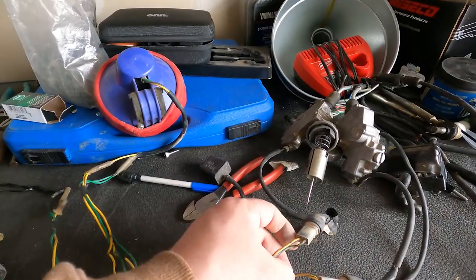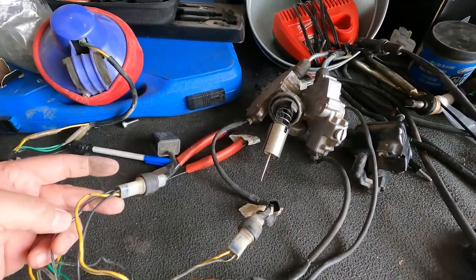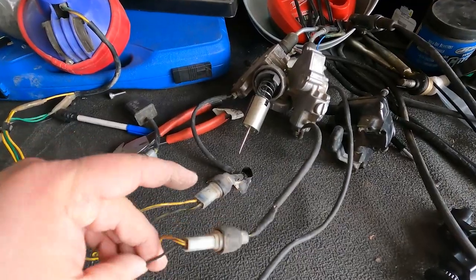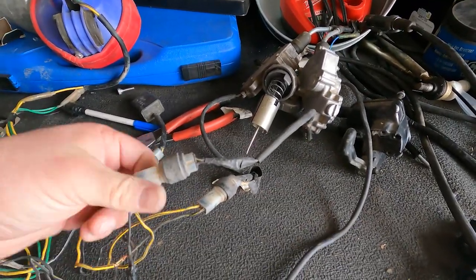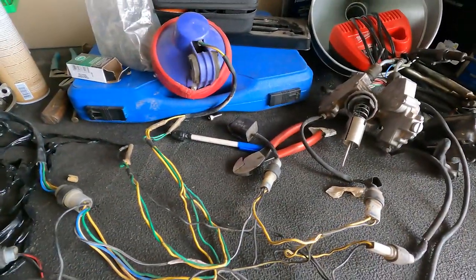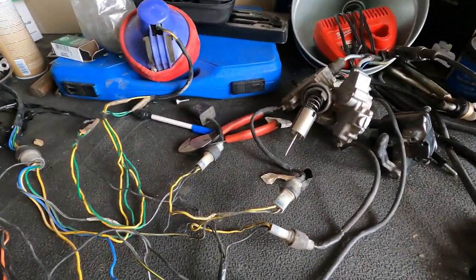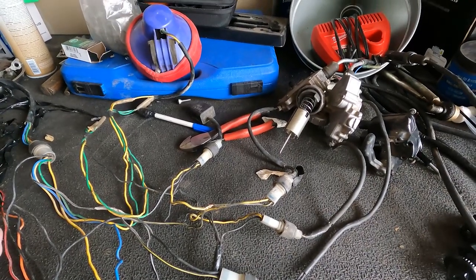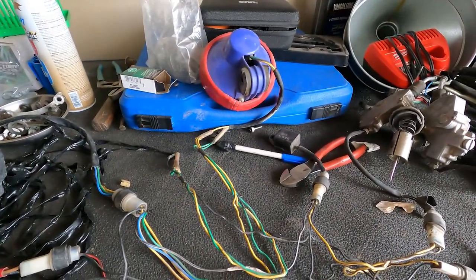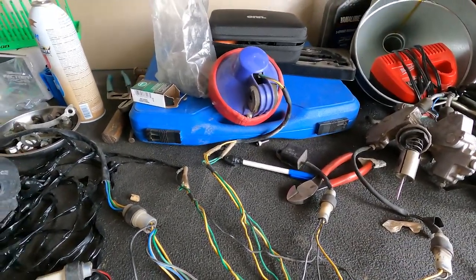From here over, you've got yellow and black is your major. There's a black and white that tie in, and looks like this one's just black, maybe. So anyways, we're just going to trace those back to point of contact, ditch them all, leave the wire harness the same without them, and then we'll get it retaped up, and I can show you guys how to test those with a couple spark plugs. It's pretty straightforward, just by plugging in your CDI, plugging in your stator and your coil.